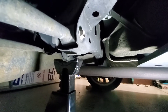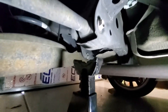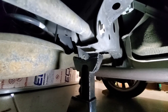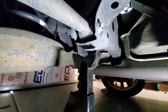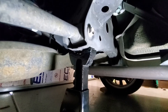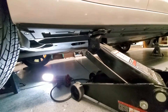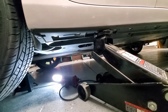We're going to go ahead and jack the car up a little bit, raise the stand arm, and then slowly release the jack so that the car gets supported by the stand. Now that we've got that in place, if you are working on the rear end only, the next best thing would be to leave the jack support in as secondary support.